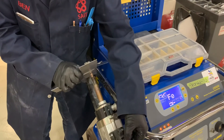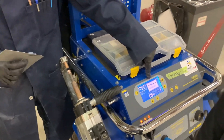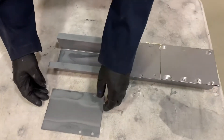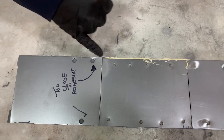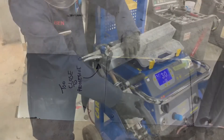Spot welders are fairly smart and will let you know if a weld has failed. As you can see in this example, notice the screen — it tells us 'wrong spot,' meaning it did not weld. Only use weld-through primer when the manufacturer calls for it, as some manufacturers do not want weld-through primer used. Never plug or MIG weld anywhere near glues or adhesives — leave at least one inch of space.